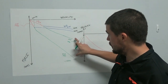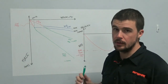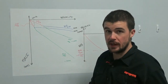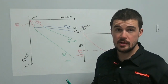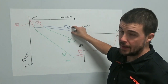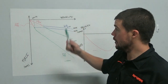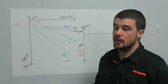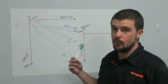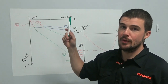The difference here is that with the high speed rebound wound fully in, we can then use the low speed adjuster within a very large range of adjustment as our primary adjuster. If we wind the high speed rebound right out, then the low speed starts having less effect. Then the high speed adjuster becomes the primary adjuster. Now, how far in does the high speed adjuster really start to give the low speed adjuster any meaningful range?